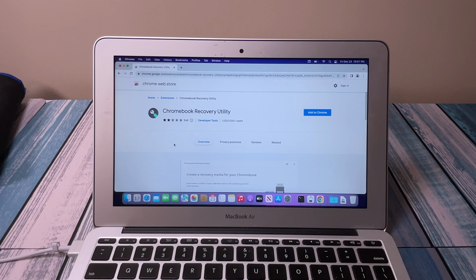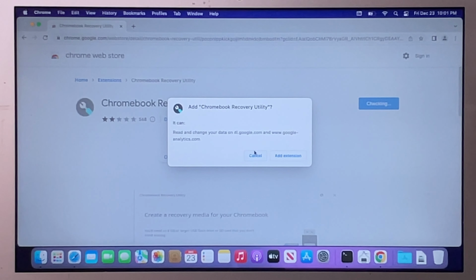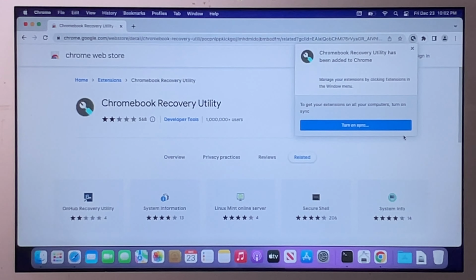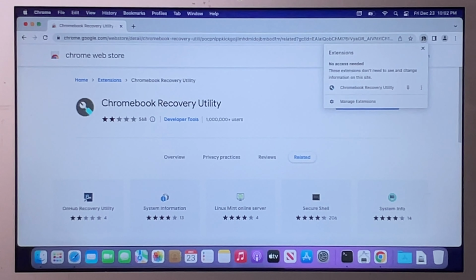So Google actually has a Chrome extension called Chromebook Recovery Utility. To use this, you have to have Chrome installed on your laptop, and you can do this from Mac or you can do it from Windows. Once we find this, and I'll put a link to this in the description below, we're going to add this extension to Chrome, and it's going to ask us if we want to add it to our Chrome extensions. And once we do that, we can find it up here in the little Chrome extension area.